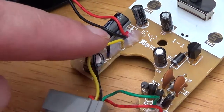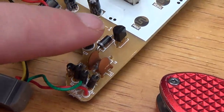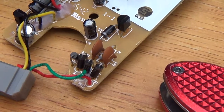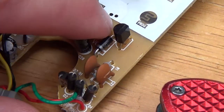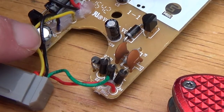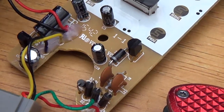The battery supply goes over here where it is filtered. There's a rectifier here which acts as a polarity guard circuit. I assume these capacitors may pass the talking and caller ID information back and forth on the line. And I assume that zener may work to limit voltage, as this will power the internal circuitry off the line when the phone is off hook, and only uses the batteries when the phone is on hook. Over here you also see the output to the transmitter.